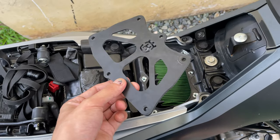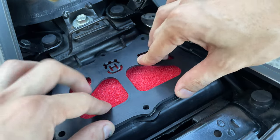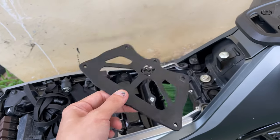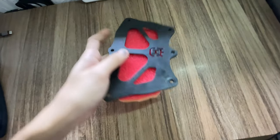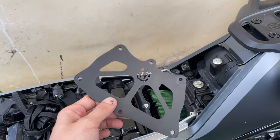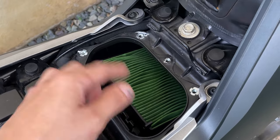Okay so now that we got this off, the next step would be to add a foam filter or a cloth filter to our new DIY 3D printed airbox lid cover. If you order the original one from Kuber, it should come with a foam filter attached. But since this is a 3D printed project, it's still technically plug and play, but you need to buy and attach your own filter or cloth fiber. You could use those round foam filters for cars or synthetic cloths from balaclavas or face masks. Just make sure to avoid cloth fibers that disintegrate, like eco bags, as their particles may get sucked up through the filter and into the engine.